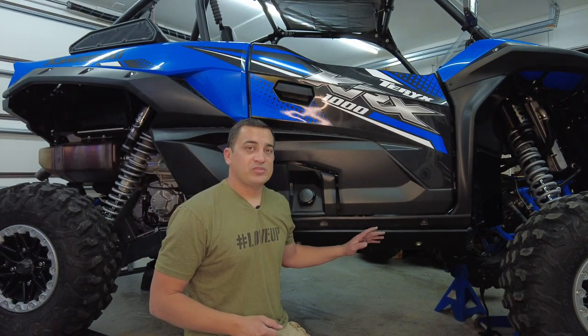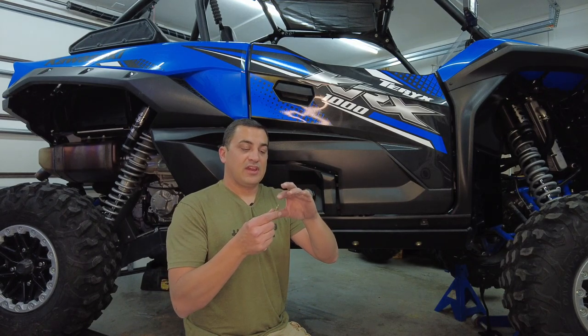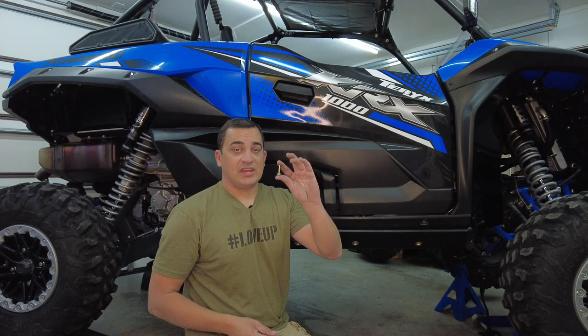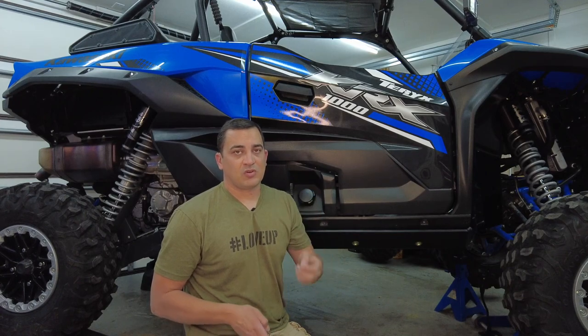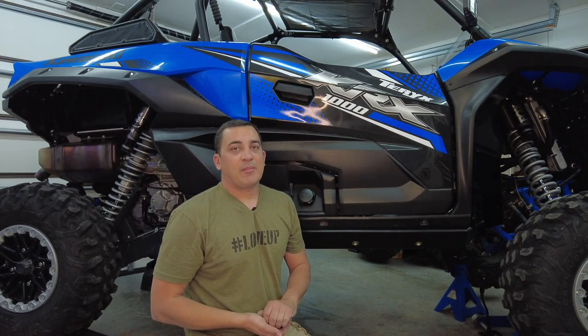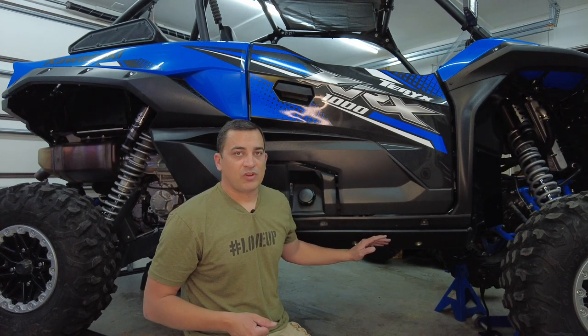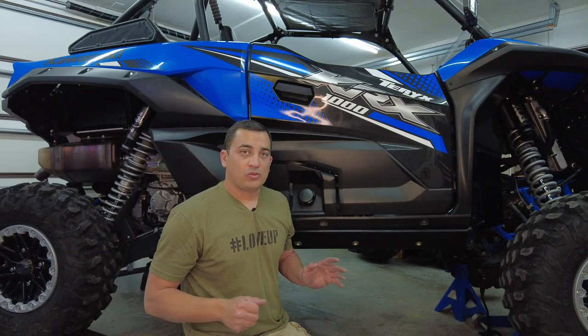So to finish up the boat side install, we're gonna grab three of the tech screws or self-tappers, the 1.25, not the short ones, the longer ones, and you're gonna grab three of the caps. Now make sure you have your safety glasses on as you are drilling through metal. There's no pilot hole for you on these. You're putting a whole new hole in it.